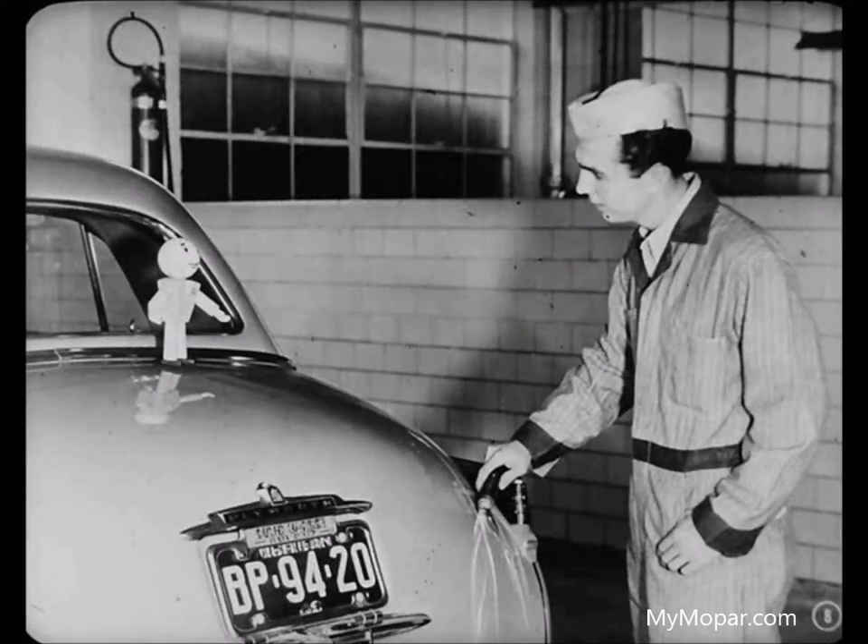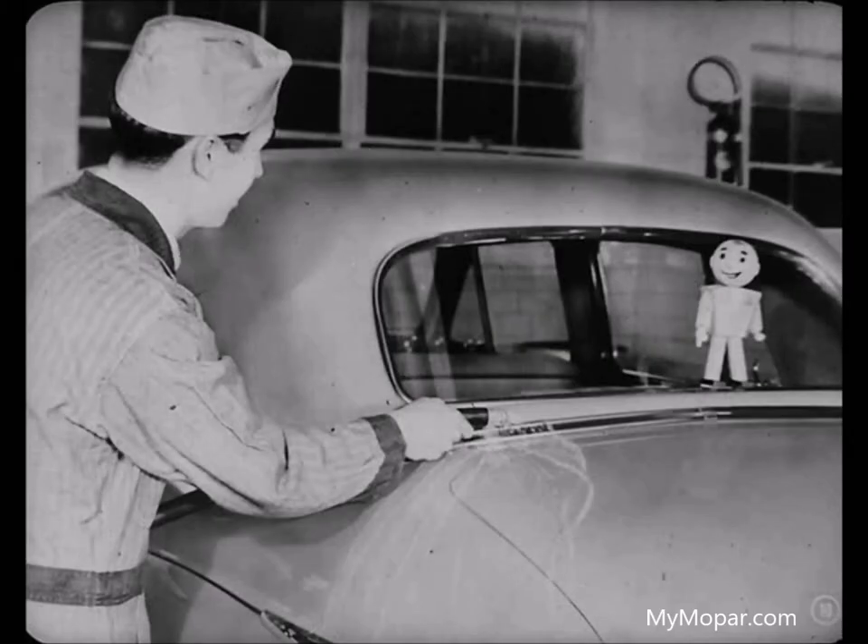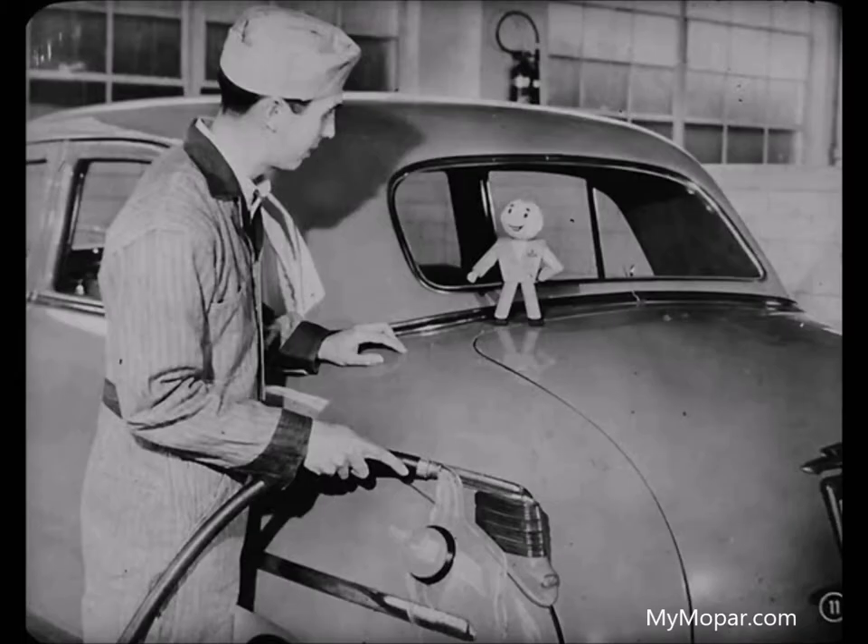Joe said to start on this side at the bottom and go up slowly, inch by inch. That's smart, Tony. Flooding the car with water only gets confusing. Section by section is the way to water test. How's this side? Okay, Tony. Now try the other side and then the top edge of the deck lid. Next, run some water over the rear belt molding and then the taillights to check for possible leaks at those points. I wish Joe would give me the whole story on body sealing. All you have to do is ask, my boy. I'll put the question to Joe as soon as you let him out of there.